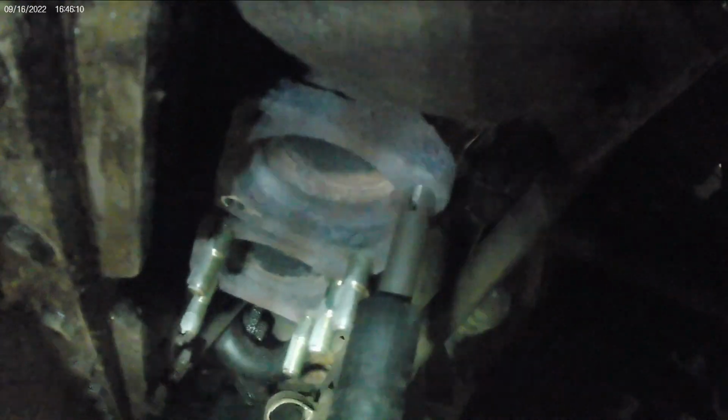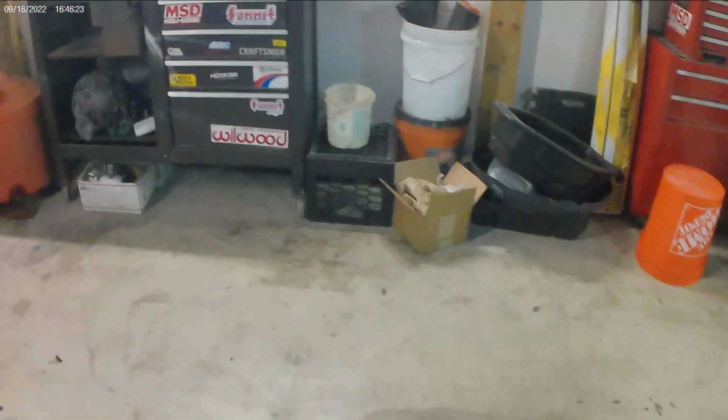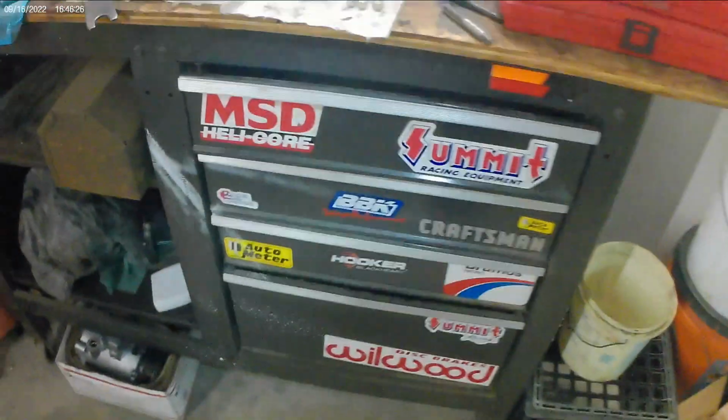This is gonna be difficult. You know what? You get the concept. It did start to move, and they do work a little bit. It's a little sloppy, it's only $40. I believe Walter makes a better tap extractor, but it's actually working. You just need to really put some pressure on it with 2 hands and manipulate the actual tap extractor itself. So I'm going to shut the camera off and let you know how I make out after. It is moving, which is a good sign, thank God.